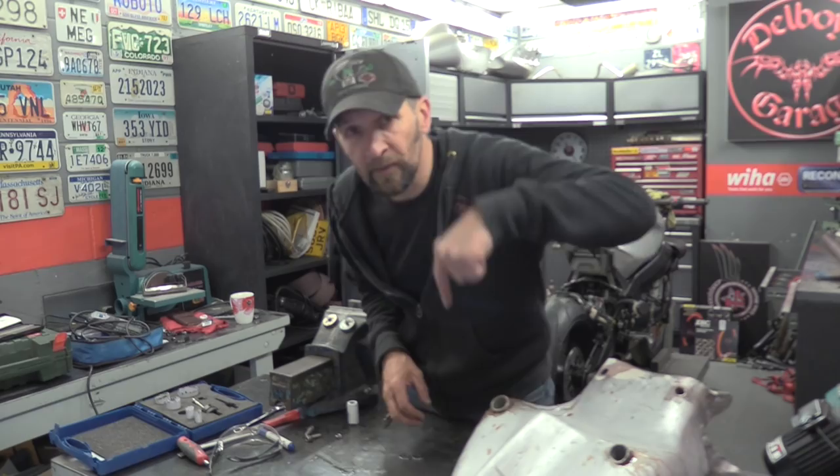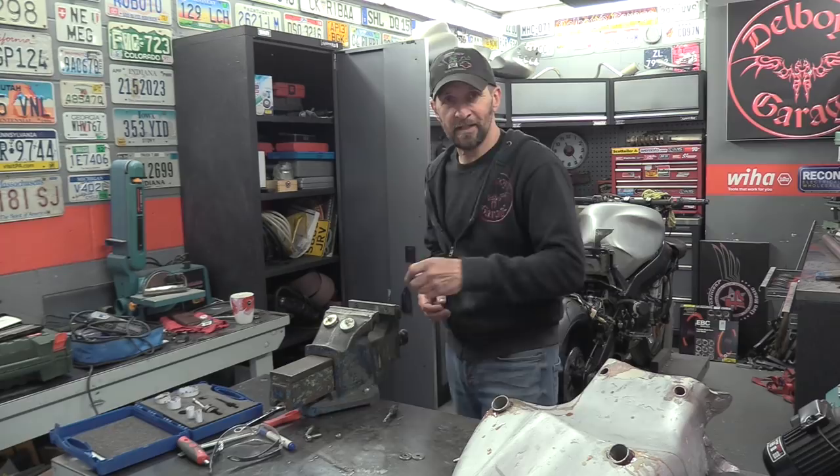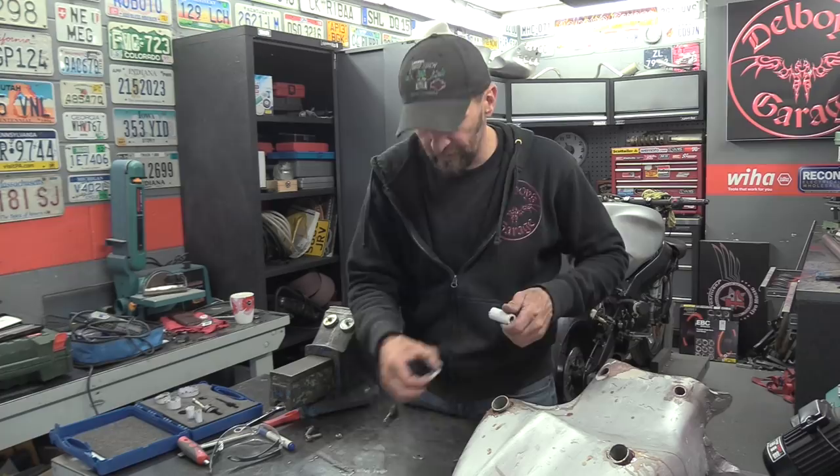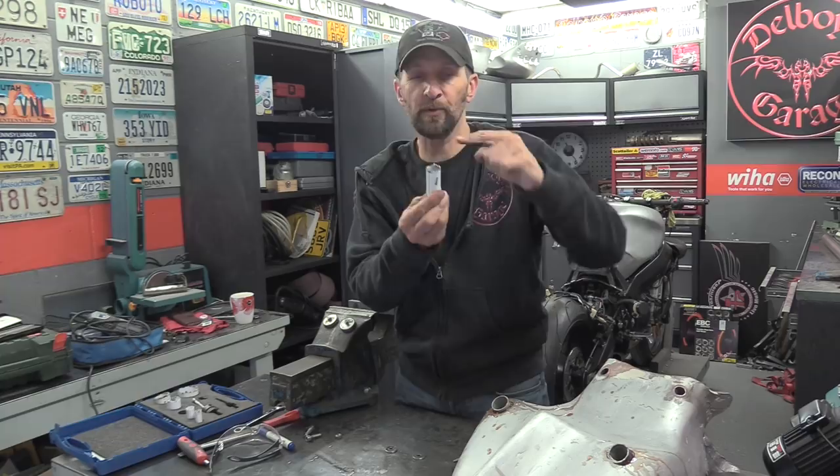So to get that cut out down in the bottom there, so it's absolutely square in the bottom and flush all the way to the bottom of the hole, just creative use of tools, a little bit like just now. I'm going to use a hole cutter and go down there, the one size that fits in there, and then just grind around in there, get all that fiberglass out on the inside, then I can put these washers right down in the bottom.